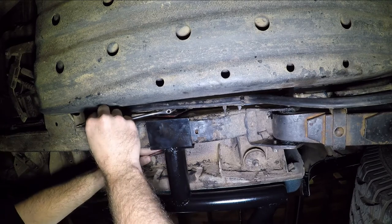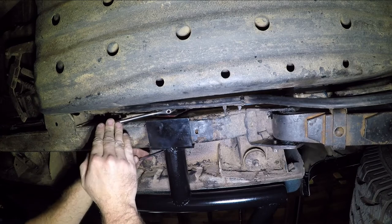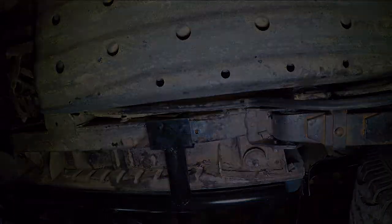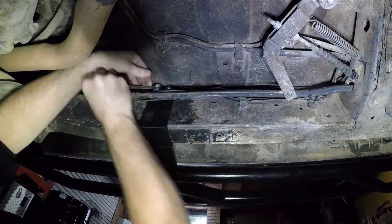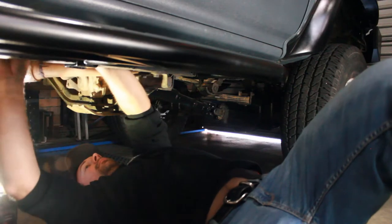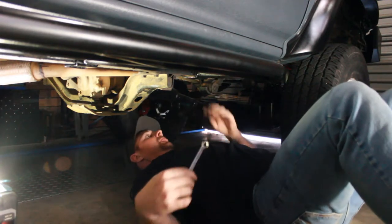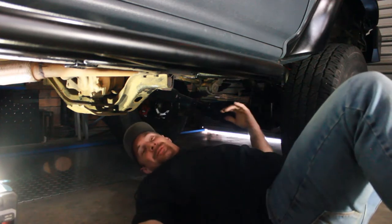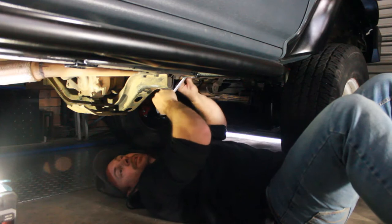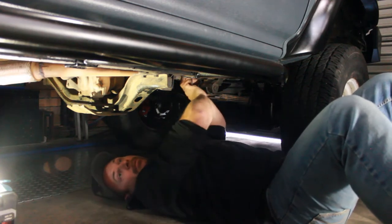A warped chassis is no good for any vehicle, so you just want to get it tight enough that it's got plenty of tension on it. I've normally got a 13mm ratchet spanner for this exact job, but it decided to go walkabouts right before I filmed this, so I'm doing it up by hand. For the bolts we've got two 8mm bolts here, two 8mm bolts here, and a 12mm bolt up the end — and that's plenty enough for some serious rock sliders.